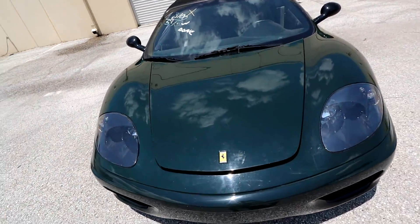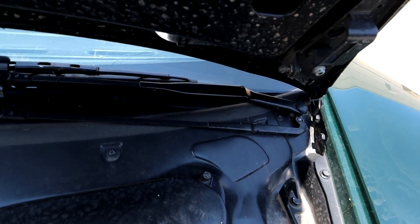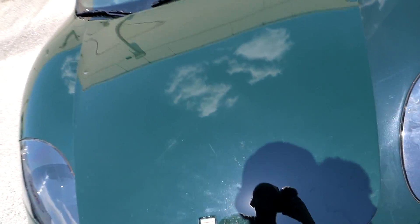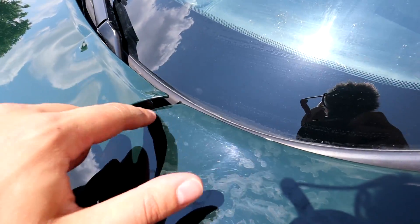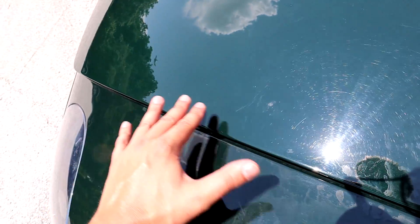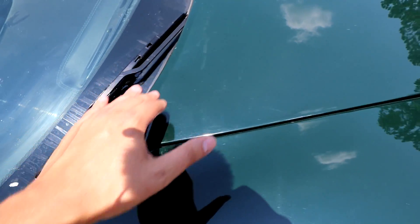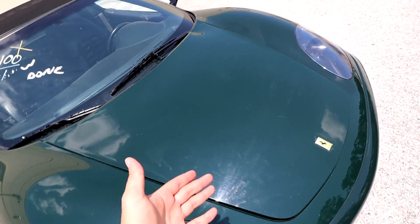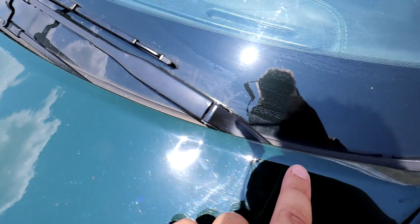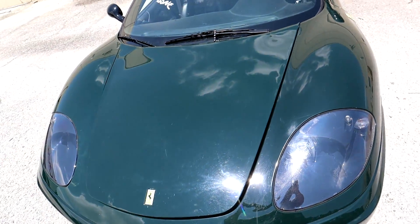The hood looks pretty good from a few feet away, but this thing sustained quite a bit of damage. The body shop might have done a little disassembly — why they would have taken the hood prop rods out I have no clue, but they're both missing. So somebody just threw this hood up as hard as they could and bent it up in the corner — it probably hit the windshield, hit the wiper arm, it's bent in here, creased along the side. We've got similar damage on the passenger side as well. This whole hood needs to be reworked, and it might be tough because it's made out of aluminum. There's a body line that goes across the entire hood right where we have most of our damage, so it'll be interesting to see if I need a new hood or if this one can just be reworked.